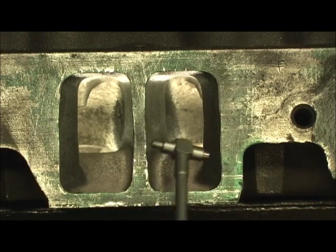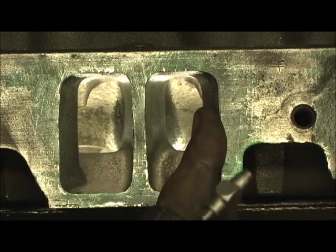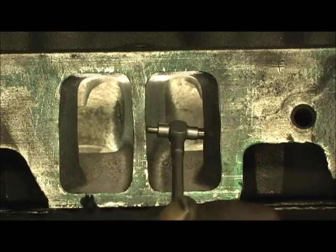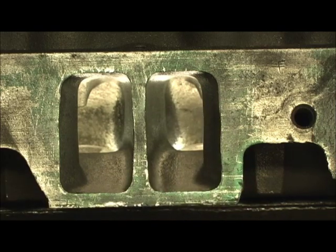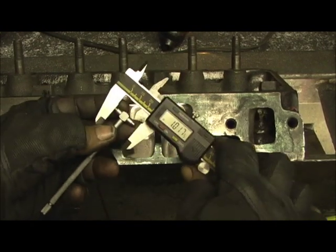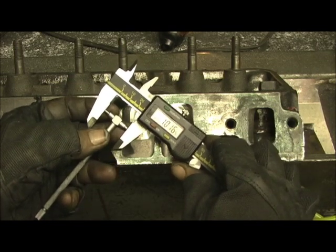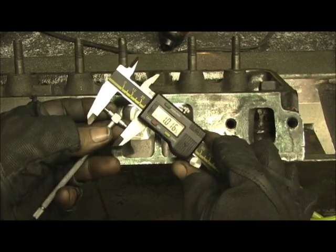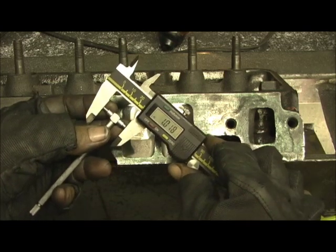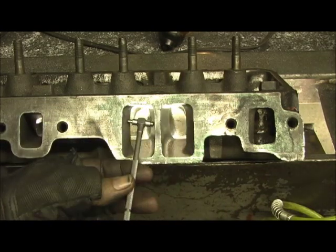You've got to be real careful in here because we're getting over to the pushrod, and once you cross over one inch you've taken a bunch of meat out of it. Let me measure it for you — okay, when I measure it I'm right over an inch, just where I want to be, about 1.117 to 1.18.